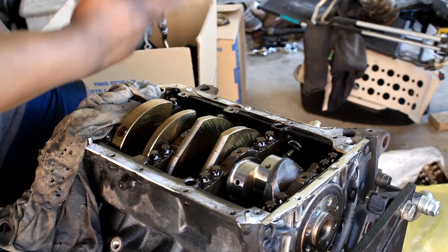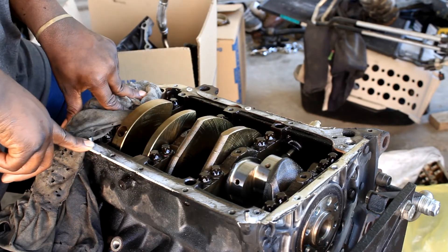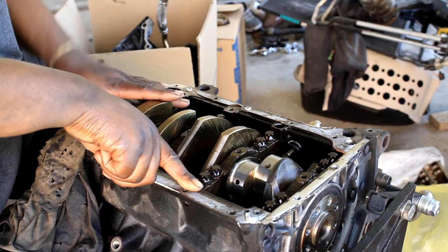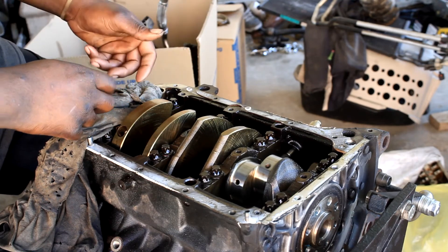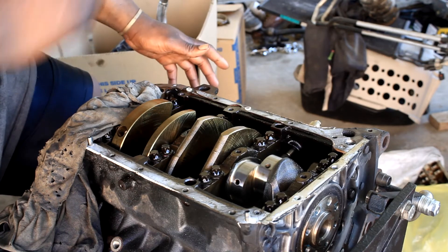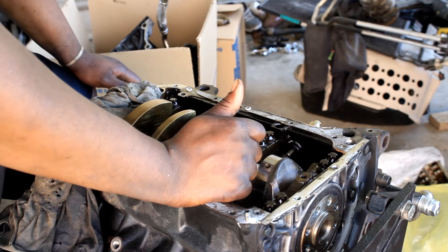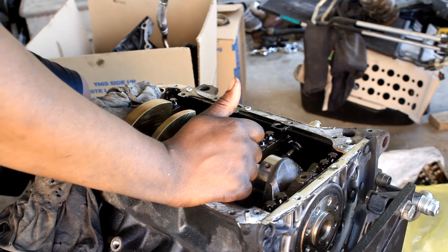Pistons are out — I've laid them to the side. I'm going to split this into a two-part series because it's already long. One important tip: make sure you lock the crank pin, and when turning the crankshaft, make sure the chain isn't binding. I wasn't being cautious and I almost broke the tensioner for the oil pump — the chain was binding on the sprocket. Back off the tensioner and you can turn the crank. The journals and everything seem to be in good shape for a 20-something-thousand-mile motor. It feels like someone's been in here before, but everything's stock. I'm going to change over to forged parts.